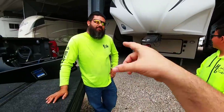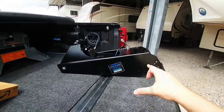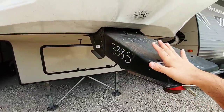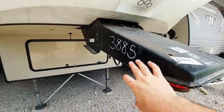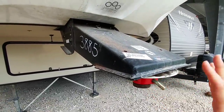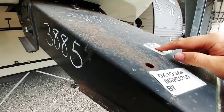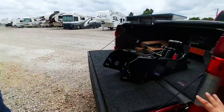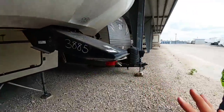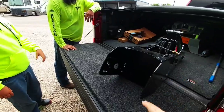So me and Albert, we're gonna go grab a beer. Can you carry this and just move it to the front? So what you're looking at, guys, is a Reese 20,000 pound rated goose box. This is going to be replacing the factory Lippert pin box on my fifth wheel. Basically, this is the pin box that comes on the Chaparral — nothing special. It doesn't have any type of shock absorber or anything built into it; it's basically a rigid unit. The kingpin's down here. I have this little friction plate that goes in between — kind of acts as a lubrication plate so you don't have to put grease all over the hitch. This one's rated right at 15,500 pounds maximum gross vehicle weight. Now we're gonna be pulling this off and installing this beast. This weighs about 175 pounds; this weighs about 75 pounds, so definitely need the help. It's gonna be a fun install.